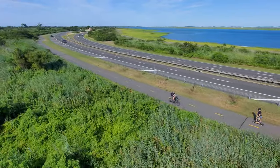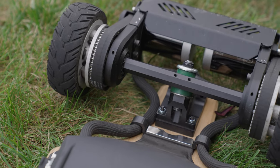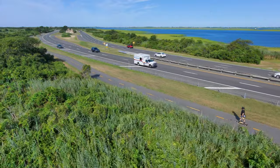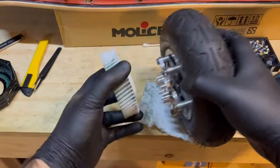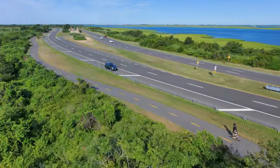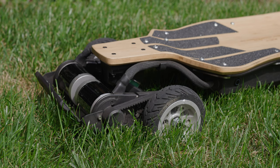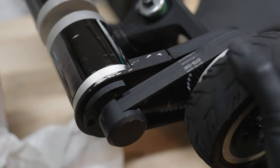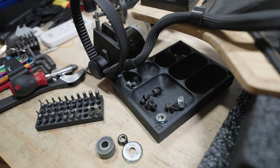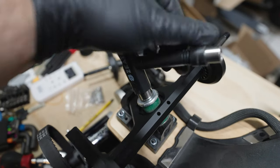In 2023, it seems that the trend is to offer a gear drive with new boards, and I am so glad that the Tabor uses a belt drive. This is another area where I've seen boards released with features and claims that most riders forget about the following season — more torque, no maintenance, quieter, whatever. The most important differences to me come from running a repair shop. When a broken or seized gear drive comes in, I end up five Red Bulls deep and cursing the world. Belt drives are practical, effective, and easy to maintain and repair. Pulleys and belts adhere to a standard, and you can source replacement belts wherever you want. Hoyt Street even took the time to address a common belt drive issue — belt skipping — by setting the motor pulley at a distance from the wheel pulley that causes the belt to engage with more teeth, adding a larger surface area of the motor pulley. Combine this with the choice of either auto-tensioning via springs or manual override to get more belt tension, and it's clear that the goal was to keep the practical benefits of a belt drive and get ahead of some of the pitfalls.